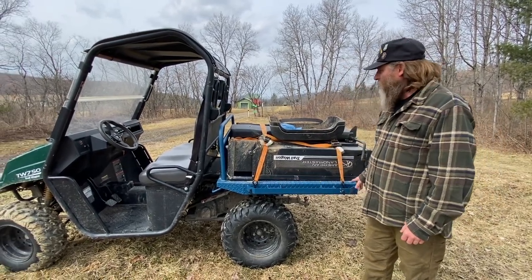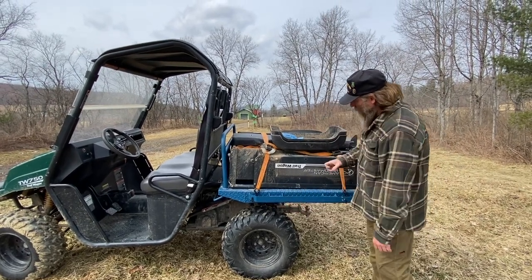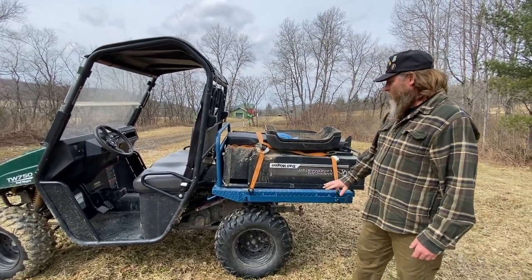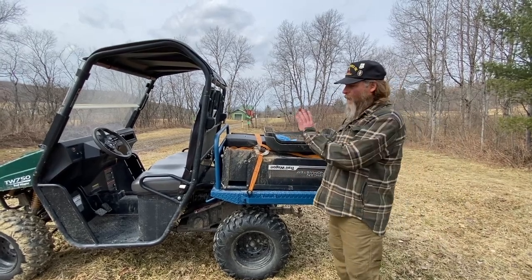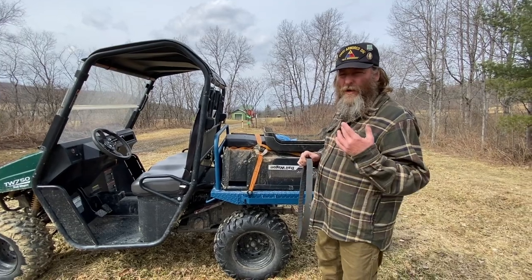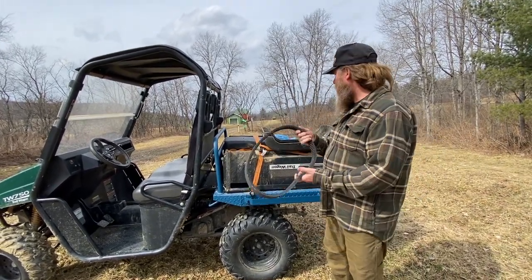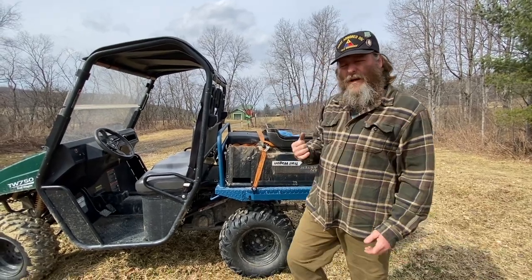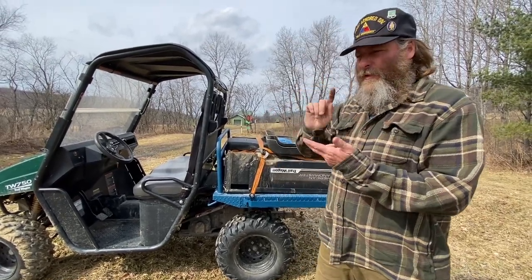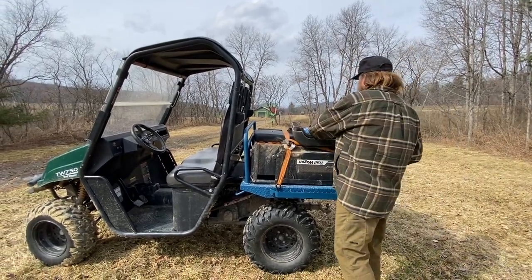I gotta make some side rails for it. The old fenders don't work anymore once you put the flatbed on them. These are these little old dump beds. But this flatbed still dumps, but we had a bunch of stuff done to it. This service stuff, oil change, fuel filters, air filters, everything. Got a new belt on it. This is the old belt. It was kind of stretched out. I got new shifter cables, throttle cables, and a bunch of joints in the front too.